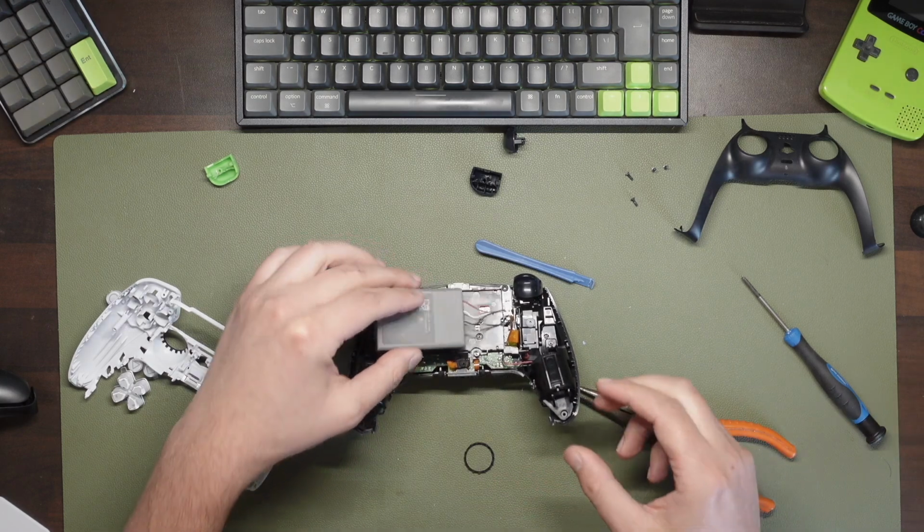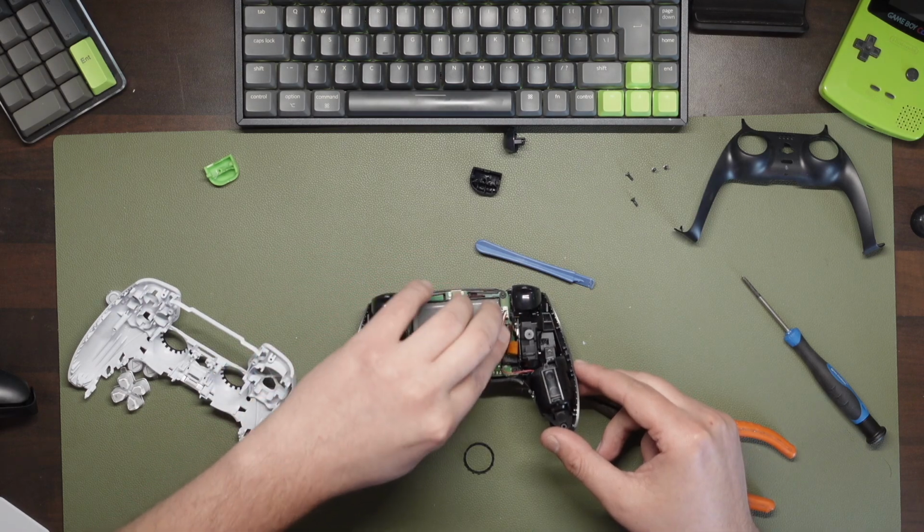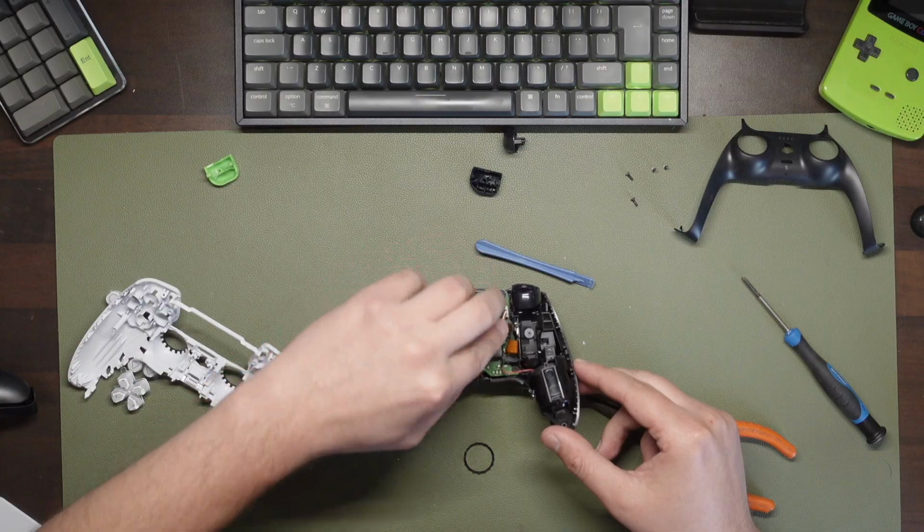Make sure you place all of them back in their original places, otherwise something won't work. Pop the battery back in, connecting it back to the white terminal at the top right hand side of the board, using the little black piece of plastic in the battery mount to manage the small cables.